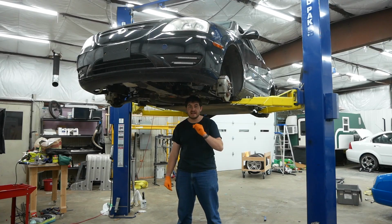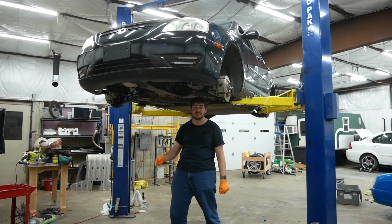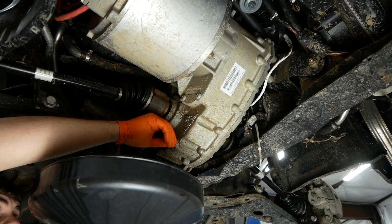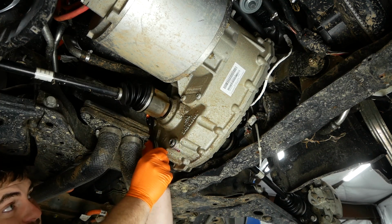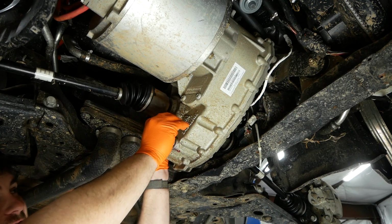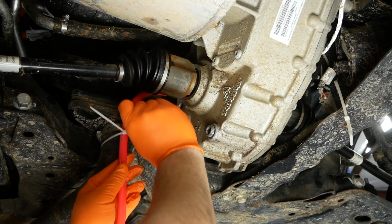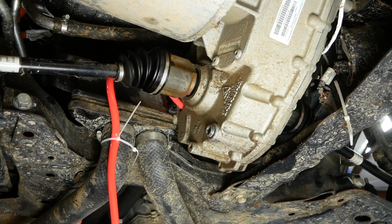We're good. I have one last thing to do under here, and that's top up the gearbox oil. When you take the CV shafts out, that unplugs the holes on either side of the gearbox, and some of the gearbox oil comes out. I just need to replenish that leaked out oil. Start by draining out the remainder of the gearbox oil. Now, unscrew the top drain plug to pump fluid into. Now I just stick the out end of my gearbox fluid transfer pump in there. And then start pumping in ATF until it comes out of the top hole, and then it's full. Yep, that's full.